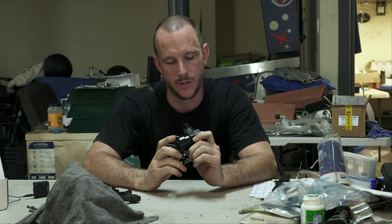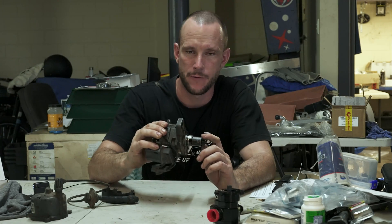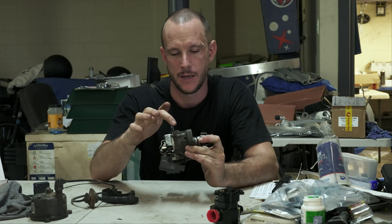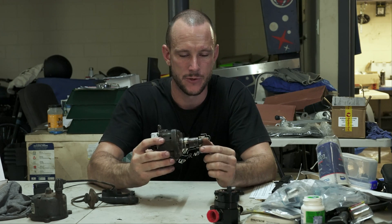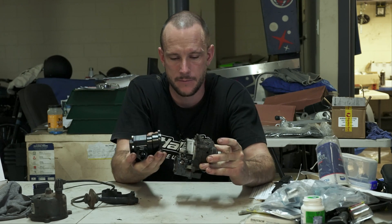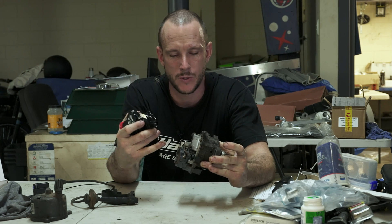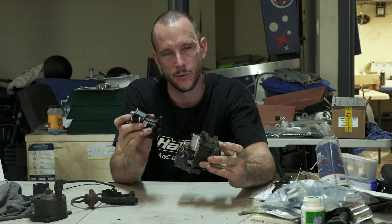I've seen cars run mechanical pumps off the front of the camshaft gear but we don't really have a lot of room for that. So I've come up with another idea - we have a factory 4E distributor, and I think if we pull it all apart and chop it down, the guts will slide straight into the head, aligning with the cam. Then we can modify the drive to suit, make up some mounts, and that should work really well. We'll then have to move the cam and crank pickups too.